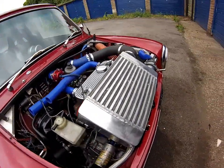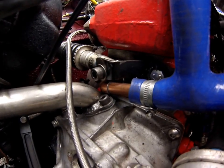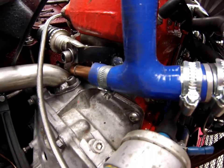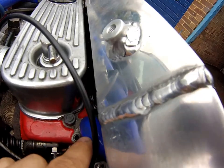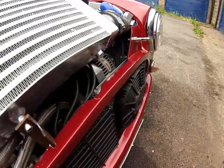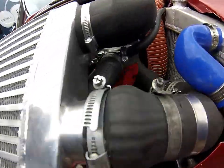On the other side of that, I've also taken a branch out of the core plug at the back, and run a loop around linking up onto the heater matrix outlet pipe, which then flows underneath the intercooler, around and onto the top hose, which runs back into the engine.